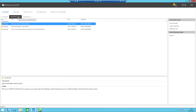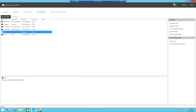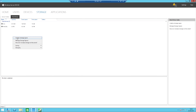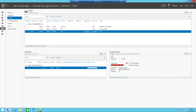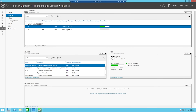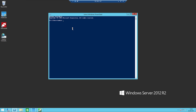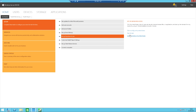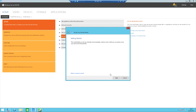Looking at performance, we're seeing about 189 megabytes per second on reads, and I think it was fairly similar for writes. That's actually really interesting, especially considering it was in a mirrored fashion. This is Crystal Disk Mark, so it's a fairly synthetic benchmark. Because I don't have both LAN connections connected at this time, the maximum throughput I saw was about 80 megabytes per second. I expect that to jump up to around 100 if I had both connected, but that is a main saturation with the drives themselves as opposed to the speed of ethernet, especially on port teaming mode.